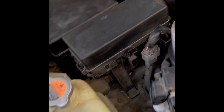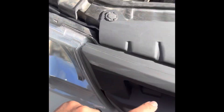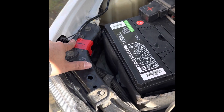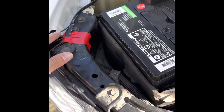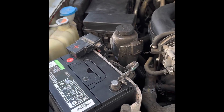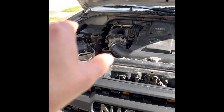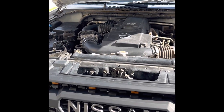I secured the fuse back in, lined the wire outside so it's out of the way, and used the wire clips along the grill area to route the wiring cleanly. Ground it first and then connect your add-a-fuse — that's pretty much it. It's pretty simple and straightforward. I'm not a mechanic or electrician and I was able to do it myself. I didn't see any videos on this specific 2017 Nissan Frontier truck, so I'm excited to be the first one covering this.